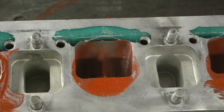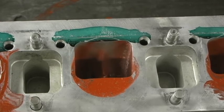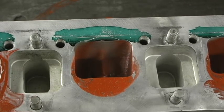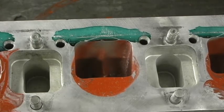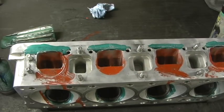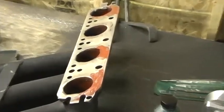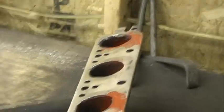Where the horsepower could really have been increased on this is if the headers would have been made to utilize the design. Apparently the header is an older-style zoomy header, and because of the bolt location, it ain't taking advantage of as much meat as I could come out that top. So, anyway, I just thought I'd show you what that looked like and the paint on it. When we go over here to the header, it absolutely matches. You can see, plain as day, how it hits all the bottom, but it just don't do the job at the top.